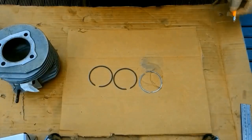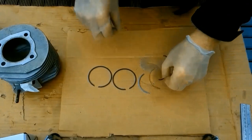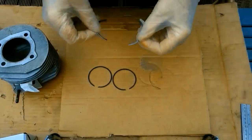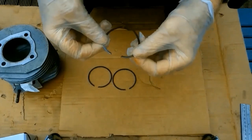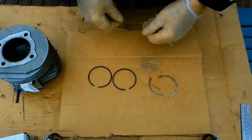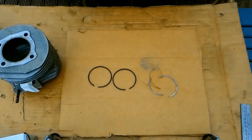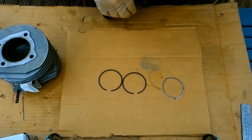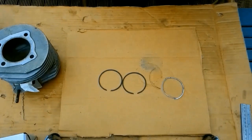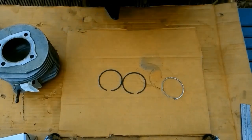Word of caution. Don't mess around in mid-air with piston rings. They're liable to break. And I have two new piston rings. The consensus is they must be fitted in pairs. The question now is, to hone or not to hone. The consensus on that is that it's more or less mandatory to help the new piston rings bed in.